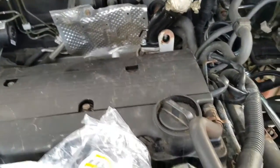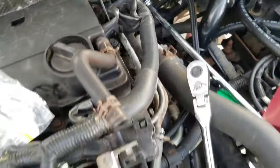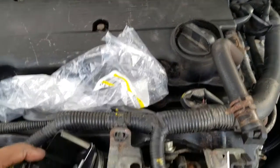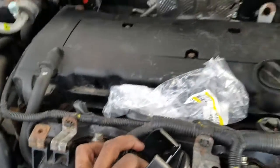Okay. So, I got the oil feed done, coolant feed and return done. Time to get the oil return done. And for this, it's a big project. We have to unbolt the oil pan and then drill a bung in it, then tighten it and gasket seal it so nothing leaks. Then we can run our whole feed, and then we call it a day. So that's that.